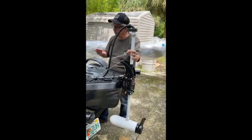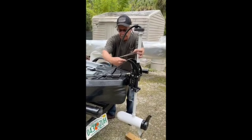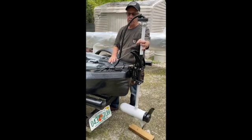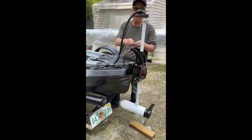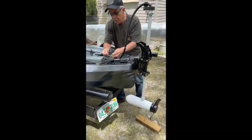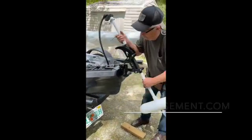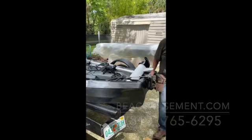One point I need to make sure you understand: the line from the top of the motor mount — when you have this in the water, you need to release that line so it locks it in the down position. Then to remove the motor from the back end of your kayak, you're going to take it off of the carabiner and release the line going to the motor mount. And you're ready to store the motor. That's it.